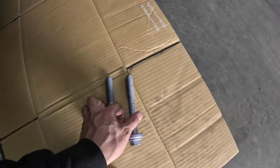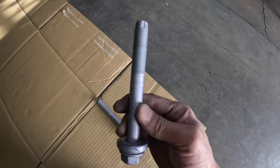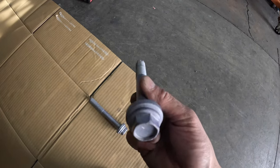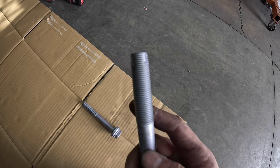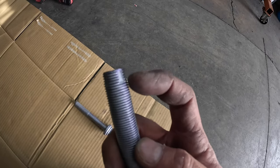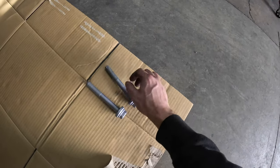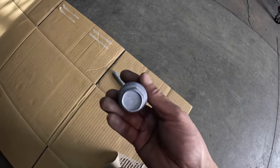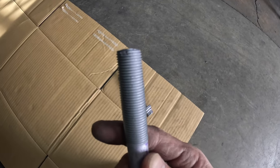Here's a better view of the two bolts. On the right side we have the model year 23 bolt — it's a 22mm head and it's got some sort of taper in the beginning of the threads as well as a few notches. The updated hardware is a 24mm head and it doesn't have as much of a taper.